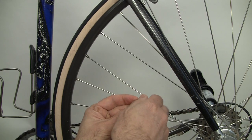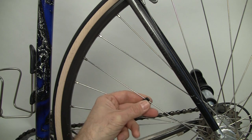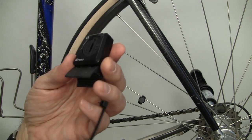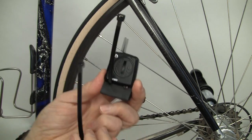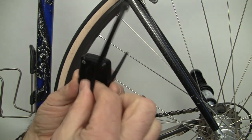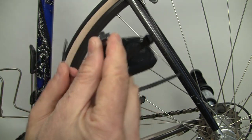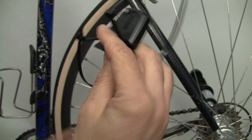We're going to put the magnet right about here — screw it, pop it on, tighten it down, but not too tight so we can move it around. Now install the two large zip ties onto the speed sensor, very similar to how we did it before. Feed the zip ties through the slots on the side with the speed and circle arrow screening. Note the orientation of the zip tie heads — they should be orientated like this and lock in like this.